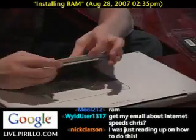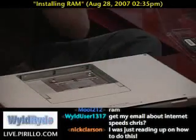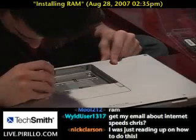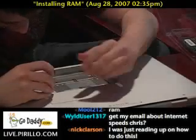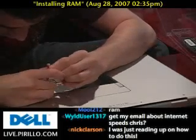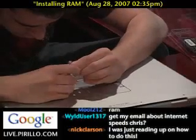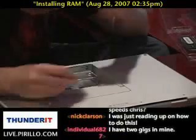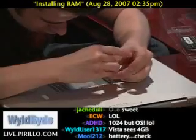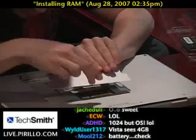So we're going to pop out the battery. I've never actually gone through and installed RAM on a MacBook or MacBook Pro — I've done it on an iMac and it was pretty simple. Now that I've opened up the battery gate, I take a little screwdriver and unscrew these very tiny screws. Careful not to lose them — these things are so tiny. If I didn't have this little screwdriver kit, I don't know how I would open this. These screws could easily get lost or eaten by a small pet.